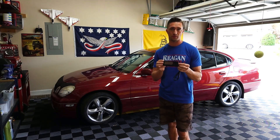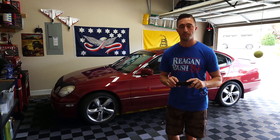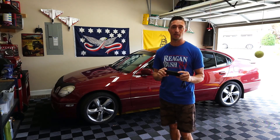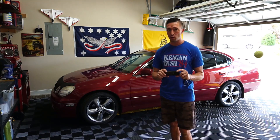I picked up one of these Apexi NEOs — I found a guy on Facebook Marketplace selling it brand new for $275. This is what you're going to need to tune a vehicle like the Lexus GS 400. We don't have much in terms of timing adjustment because it doesn't adjust timing, but it does adjust the air and fuel going to your engine, and that is what you need to get more power out of this car.